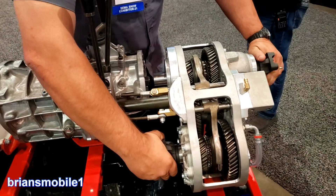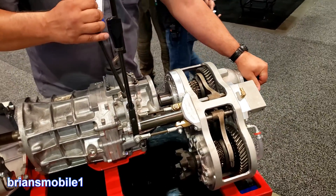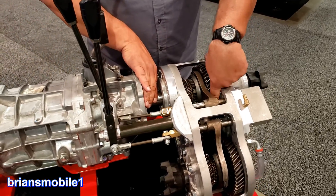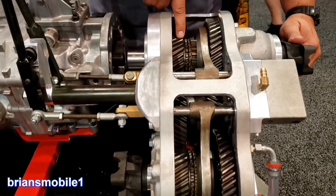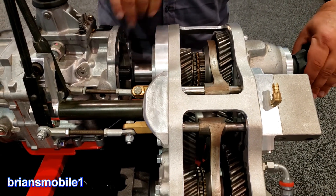Back to neutral — two-wheel drive high range. Then we can shift this one all the way through the low range. Power comes in here, goes across the gear reduction, comes back up to here. If you'll notice the speed difference between these two gears, that's your gear reduction, and just the rear is turning.